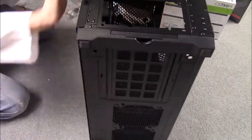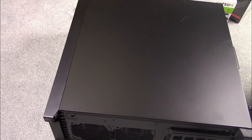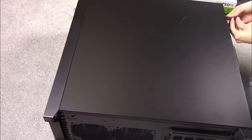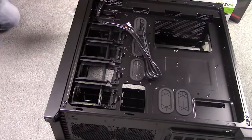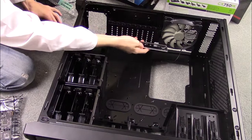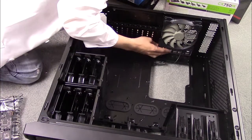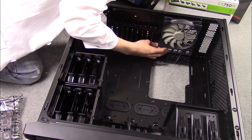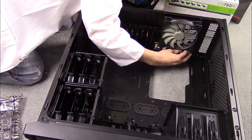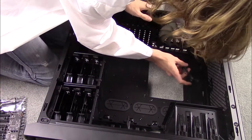While you're at it, go ahead and take off the right panel on your computer. This is for cable wiring and access to the back plate of the processor — you'll need it off eventually. This is the back plate that came with my motherboard. All motherboards have their own unique back plate, so if you have a different motherboard yours will look completely different. However, no matter what it looks like, it will still fit in the small rectangular slot on the back of your case.